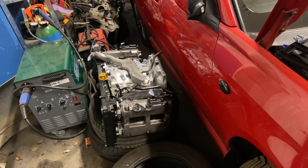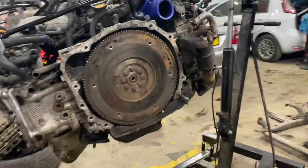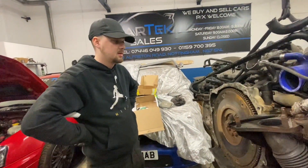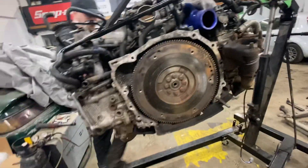All the bolts are out and everything else is out — just jacking it up now on the engine lift. It's already separating; a seat belt has been wrapped around the manifold and it's coming out. It's out! The clutch has been taken off and inspected — it's alright — but a brand new clutch is going in anyway. It held up well, doing about 350 brake horsepower. You can still see the silicone from the first episode.